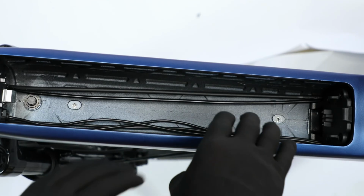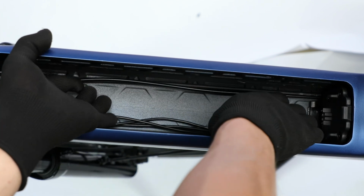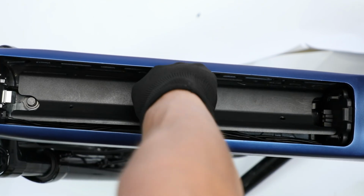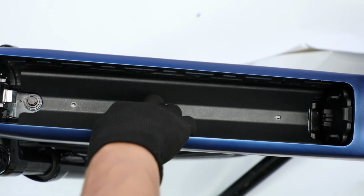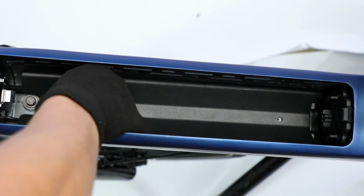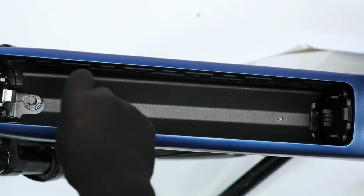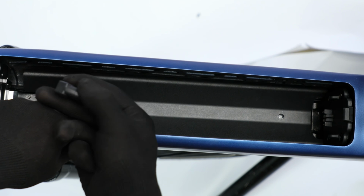With the bike positioned upright, move the cables to the sides and replace the battery tray. Align it to the mounting holes. Reinstall the 2 battery tray mounting bolts using a 2.5mm hex wrench. We recommend stuffing a small towel around the terminal to prevent the bolts from falling into the frame.